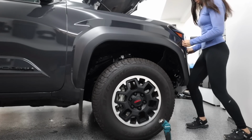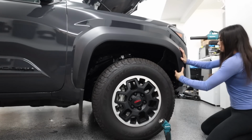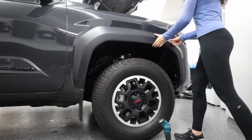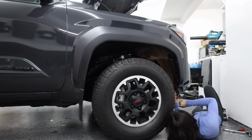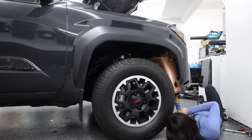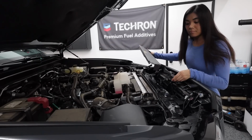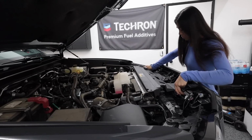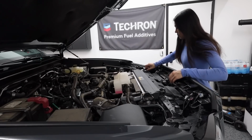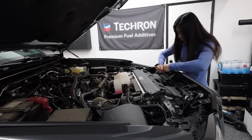Sides for me were at first a little bit tricky to snap in. Again, this is a key reason you want to make sure the grill is aligned before pushing hard. As you're working with plastic, what I've learned is that yes, sometimes you have to use quite a bit of force to get something to pull out or snap in, but if something really feels like it's too difficult, like you're going to break something, or you start seeing plastic turning white, obviously you have gone too far. Reassess, try to see how things fit together to the best of your ability, realign things, and then try again.